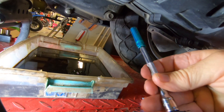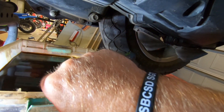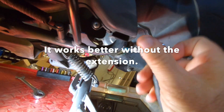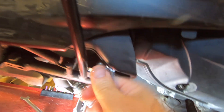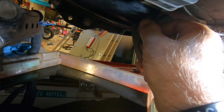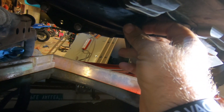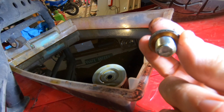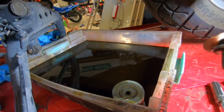Take your 8 millimeter socket — I'm using a quarter inch drive with a little swivel on the end. There's kind of a weird angle on that top bolt so you may need a swivel or a wrench, but I'm going to use this and get these taken off. You can move the kickstand out of the way if you want. Pull that bottom screen — you're probably not going to get a ton of oil out, but I like to clean it up and put it back just to inspect everything and make sure I'm not getting any weird leaks. That bolt also has a brass crush washer that you may want to replace, but I'm not going to replace it since I haven't had any leaking problems.